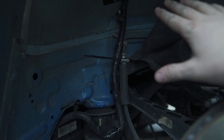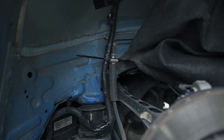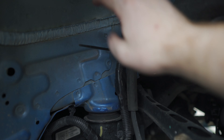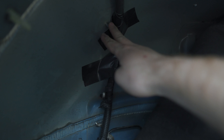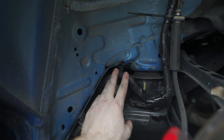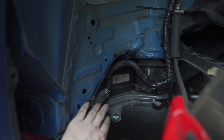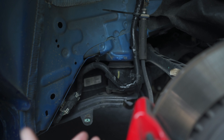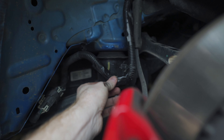All right guys, so that's basically going to wrap up this whole project. It only took right around 15 to 20 minutes — most of it's getting your car jacked up and getting the fender liner back. Really easy to do at home. We have one zip tie holding on to the aluminum part right here on the brake line. We're going to tape this down just to make sure it doesn't move. It's also going to be locked in by a bolt or tab up here that the fender liner will cinch in. Down here we also want to make sure it's not bunched up — don't want to put any extra strain on the actual connection. We also taped up the harness a little bit around some of the abrasion points just in case, since the car is going to be moving, vibrating, shaking — I don't want anything to start to chew through.